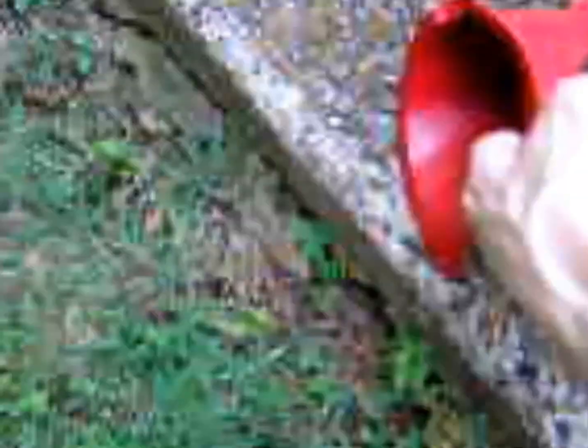You'll want to replace the ring around the bolt. You'll need a funnel. I would recommend one of these to get the filter off. I didn't need one last time, and the manual recommends 10W40 for this bike. So we'll get this going.